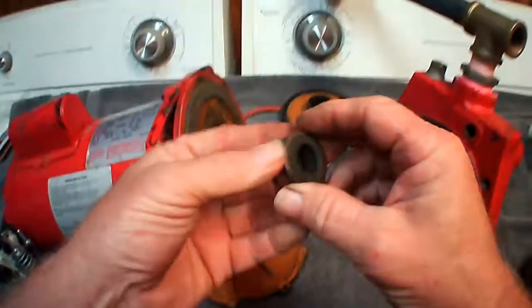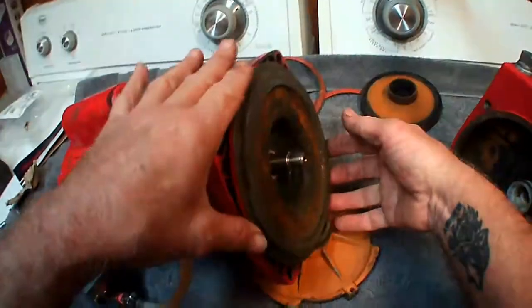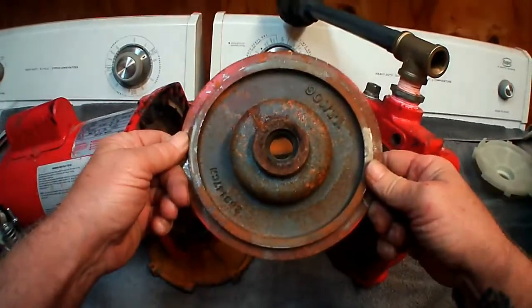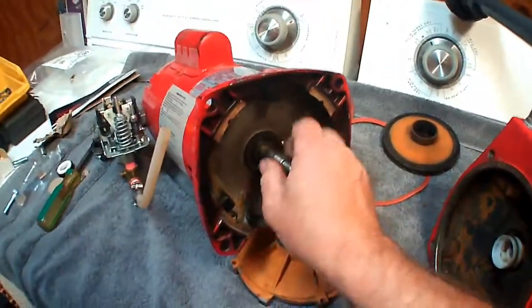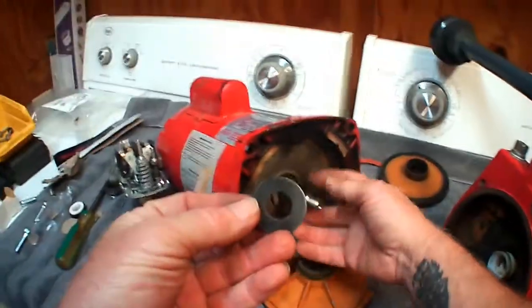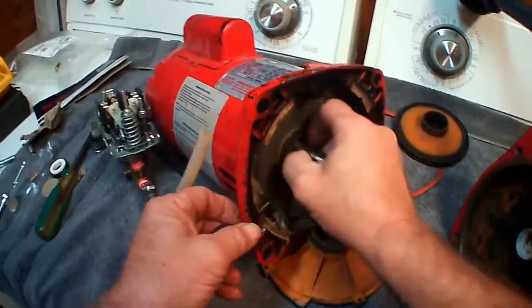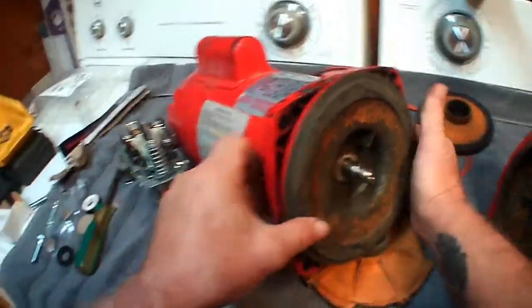Your bearing again — see how it goes in there. This is the motor side. Bold seal plate, which I've cleaned up extensively. That's what the inside plate looks like. Inside of the motor it still runs fine — beautiful motor. Cleaned this up a little bit. The new kit came with this washer, so I'm going to assume that is a replacement for that one. When you are reassembling it, the new washer would go in there, this plate goes back on. That would simply go on there like that — it's just metal against metal because your seal is out here.